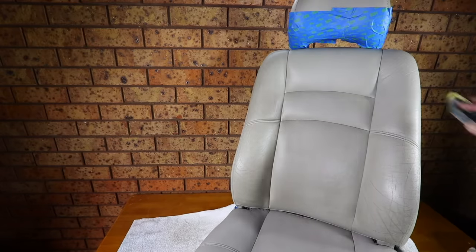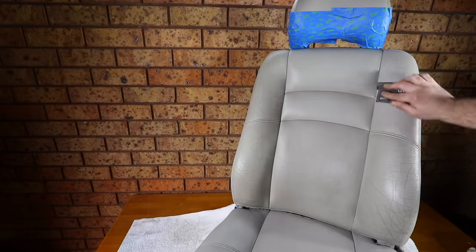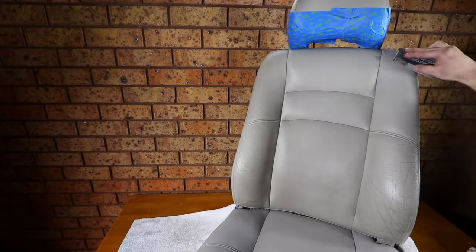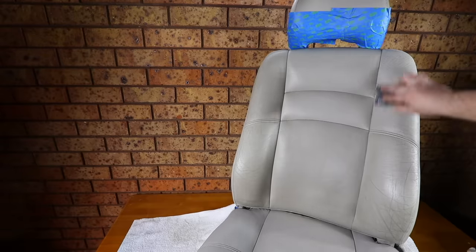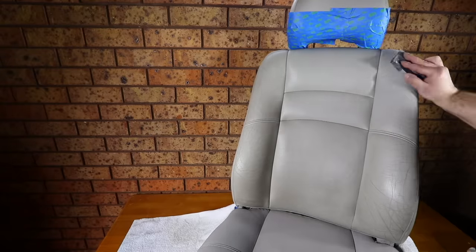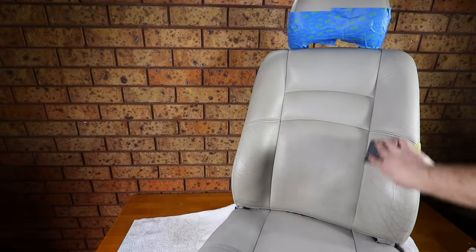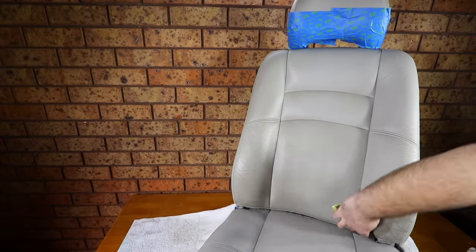In this next repair scenario, I want to show a more common and perhaps a more appropriate repair, where the side cushioning bolster is repaired and then blended into the rest of the seat. Now, the preparation of sanding and leveling the surface, followed by filling in the cracks, is much the same as the last area I just did on the base of the seat.